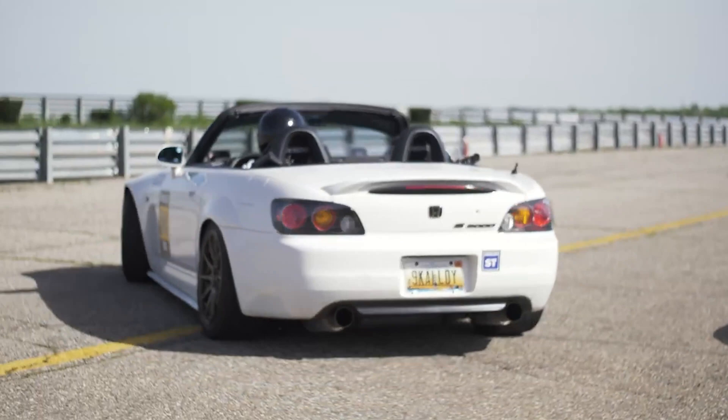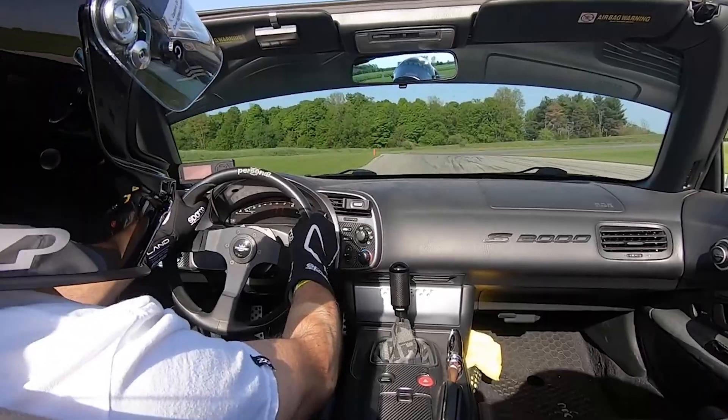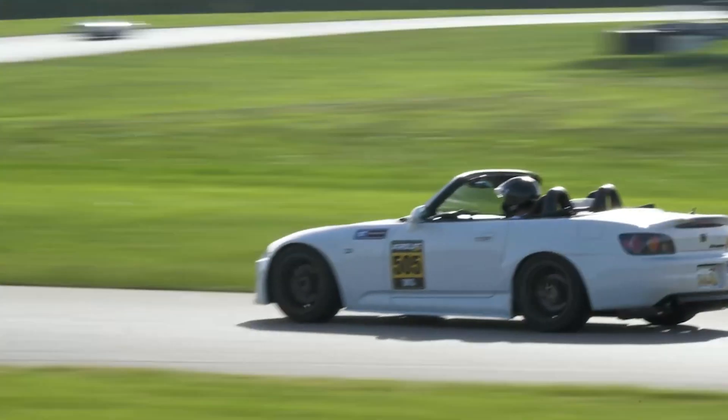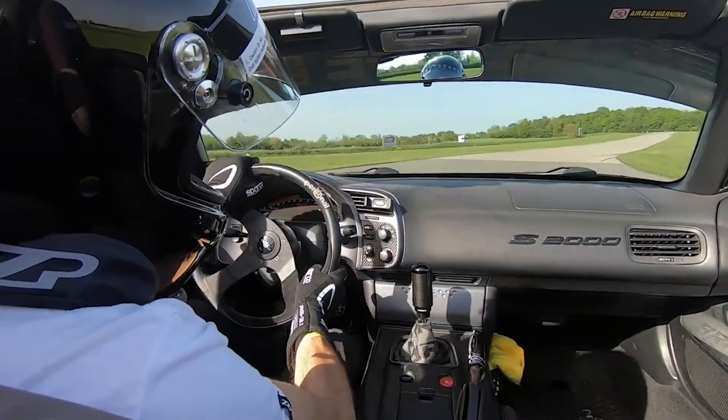I've spent a lot of time — hundreds of laps, many different states with road courses. I've raced my ATS-V, my S2000, I've raced Cobalts, ATSs. Every car I get into has a different feel. I have a very specific way I like the car to feel — I like the car to come into the corner a little on the loose side and maintain a little bit of oversteer. So generally I end up running a stiffer sway bar on the rear than most people. With the S2000, I had three rear sway bars for that car and did have to change between tracks based on corner styles and driving style.